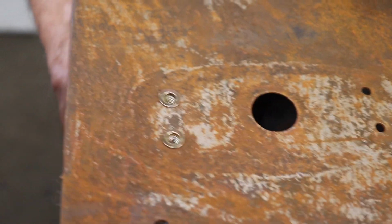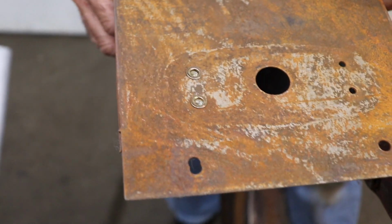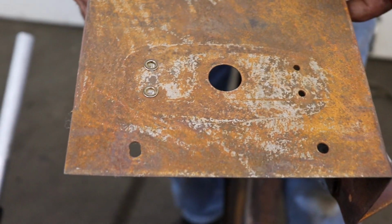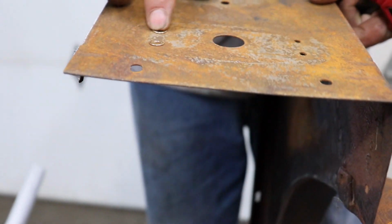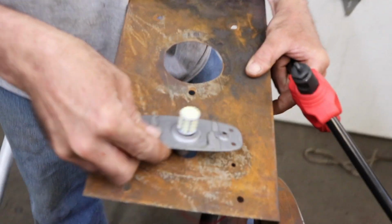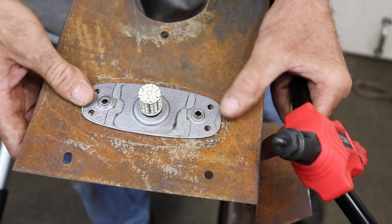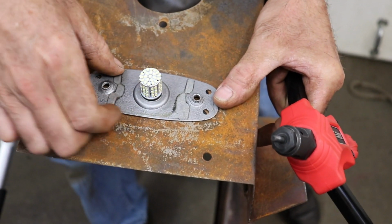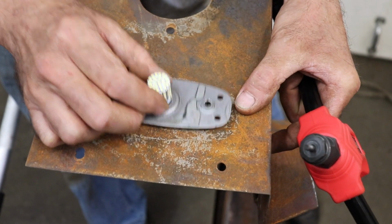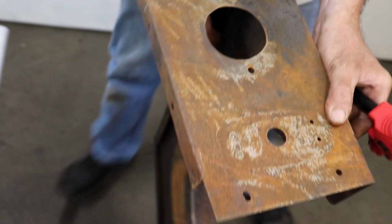So there. Now you got about 3/8 of an inch of 10-24 threads in there. But like I said, it sticks up a little bit. So in this case, what I'll do is when I mount this, I'll make a gasket that goes behind it. So when it's bolted down, you're gonna have that little gap behind it, so I'll make a little rubber gasket to go behind it.